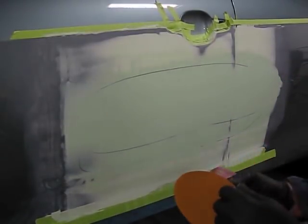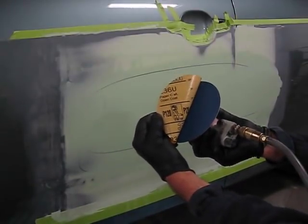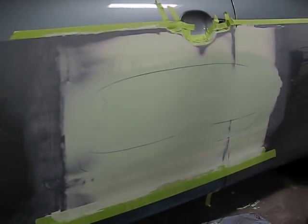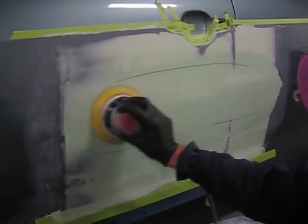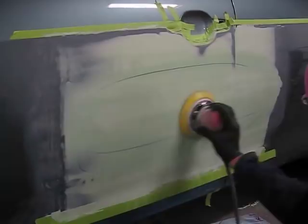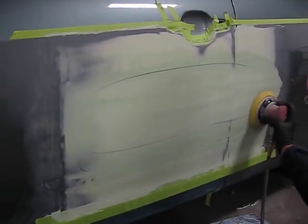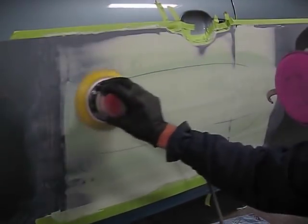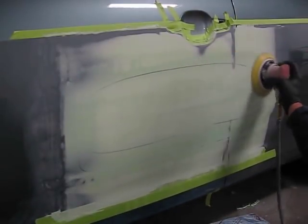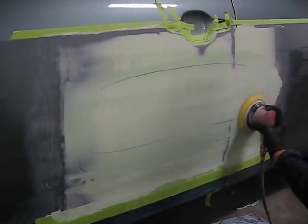Again, we're using 150 grit this time, just to make it a little bit quicker. Still a very fine paper. We can see that it's sanding down much nicer this time. It's completely filled. It has a beautiful shape to it. Again, we're working up to a perfect shape through consecutive sweeps, addressing the low areas that we find as we approach final blocking.